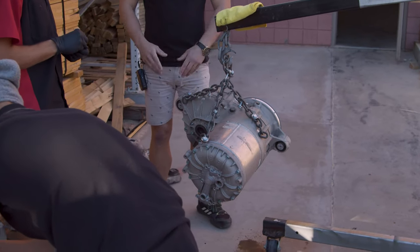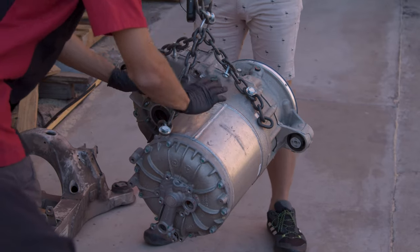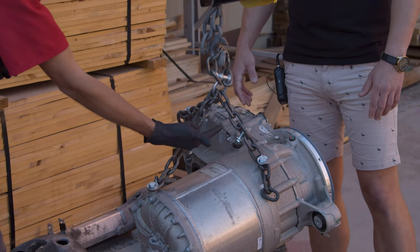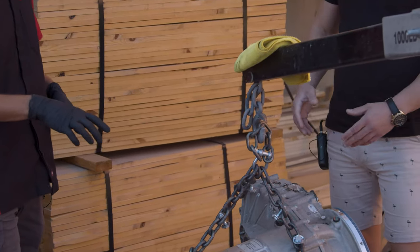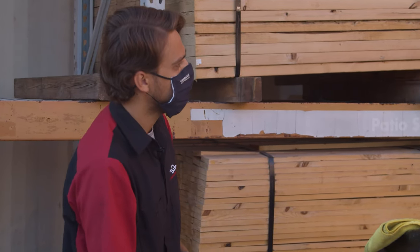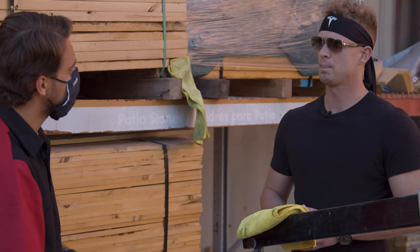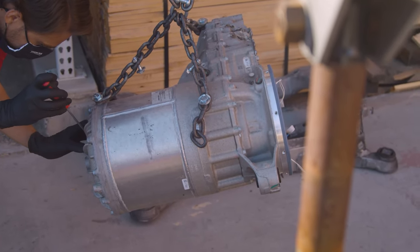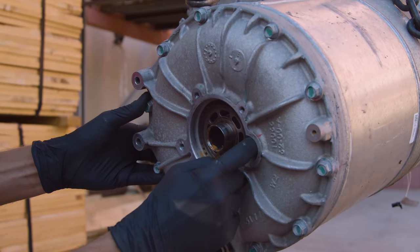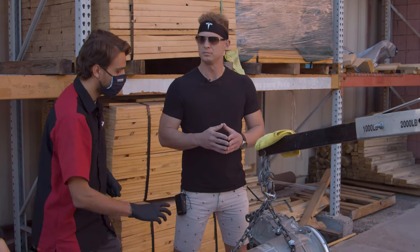So what likely caused this: inside the drive unit, coolant is running through it cooling the stator and the rotor. One of the ways they cool the rotor is by running coolant right down through the middle of it. To do that, they need all kinds of seals to build a mechanism like that. However, this seal has a known issue where coolant can leak past it. We can check around the motor encoder on the left-hand side of the unit — if we find coolant in there, that's an indicator it's been leaking past and filling up inside the motor side of the drive unit.